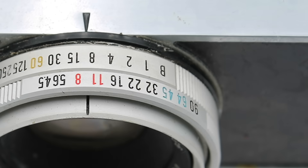This ring also has a B setting — like the Model 95 camera we looked at last time, this stands for bulb and is a long exposure setting. When you set this to B and hold down the shutter release, the shutter will remain open so long as the release is pressed.